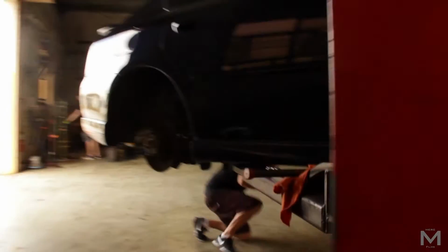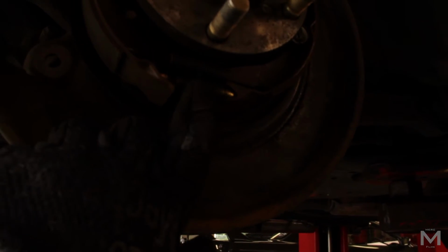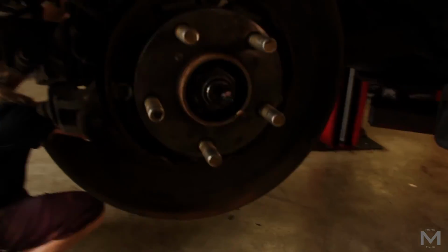That's good. Alright, so we're here at the auto hobby shop, and my dad's taking off the other side wheel right now, or the caliper on the other side, but I got this side off. Now basically, in case you guys don't know, there's a way to adjust the handbrake. There's a little cog right here. I don't know if you can see that little cog. You adjust that one way, it either tightens or loosens it, and basically you adjust that to adjust your handbrake. So I'm going to adjust it. So yeah, we'll be right back, and that's what we're doing.